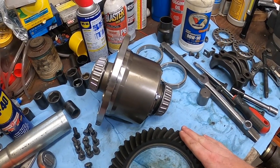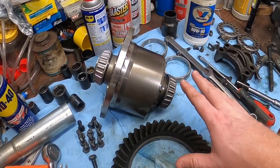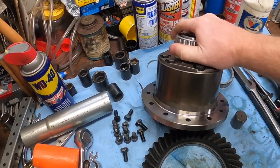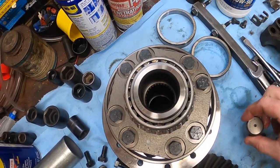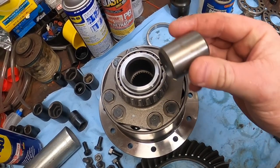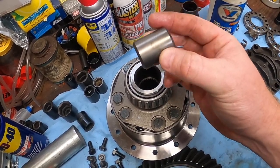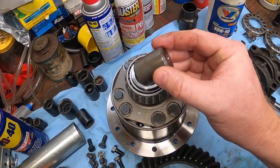Since we're not changing out the axle bearings and not stepping up to the famous green bearings, Eaton includes this small billet spacer. This billet spacer drops right in the middle, because this is what's going to keep your axles from sliding in and out if you don't have the green bearings. The green bearings will hold your axles in place, but if you're not stepping up to those, you've got to have this billet spacer — just like the factory had — that allows the axles to connect and not slide around. Do not forget about this or you're going to have some blown axle bearings real quickly, because they're going to walk around inside that differential.